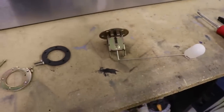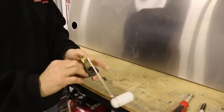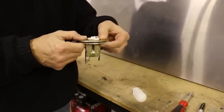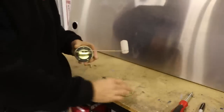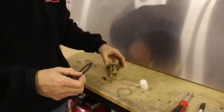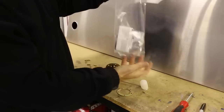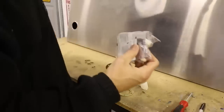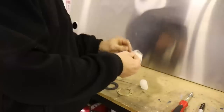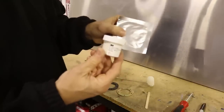The way this works is they give you a rubber gasket that goes on here, and then on the inside of the tank this ring will go on, the screws go in and tighten up. If you think you could install this and have that gasket alone prevent leaks, good luck — you'll be ripping your fuel sender out very quickly. What you need to do is go to vansaircraft.com and order some Pro Seal. It's from 3M — a container of basically fuel tank sealant. We used to use this stuff on the F-16 to seal the canopy. It's nasty to work with.